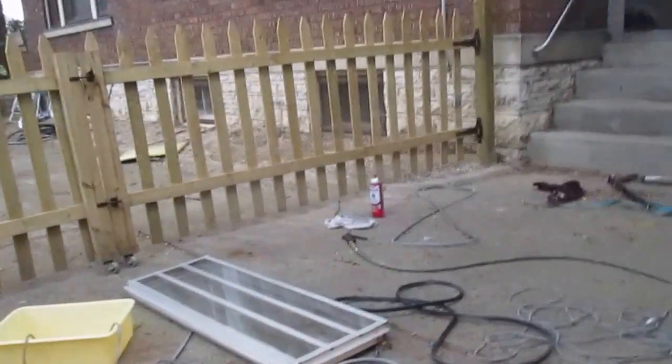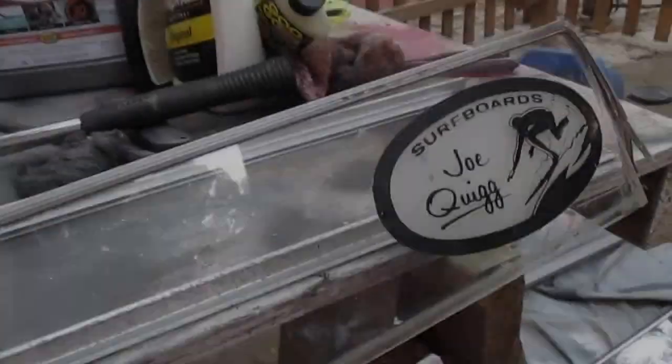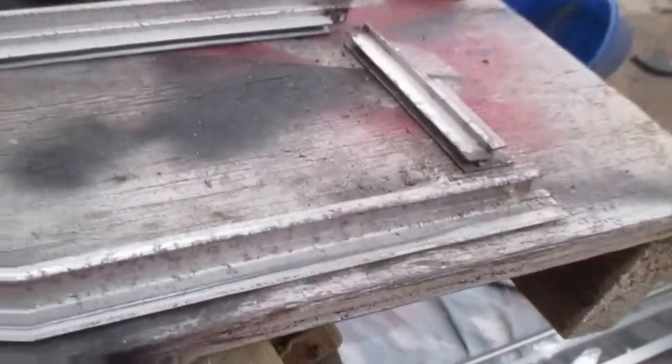Now I've got to work at getting this top edge off. Just be gentle. I'm just wiggling the rail a little bit and putting a little force on it, and it's starting to come apart there with my thumb. But again, take your time, work slowly, don't break your glass. I went ahead and laid the glass flat with the lip over the edge and the screwdriver against the metal lip and just tapped it lightly, and that's gotten me enough so that I can get him loose. So he's loose now, I should be able to work him out. Now with the glass out, here is the way that the frame goes back together.